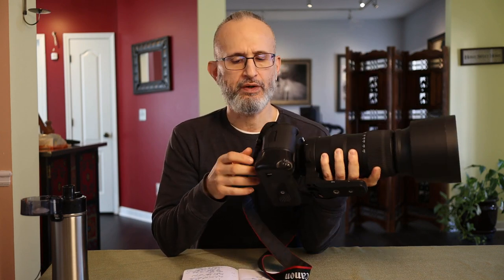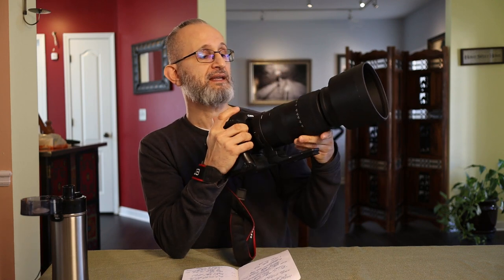This thing is built using three different materials. The inside is a magnesium alloy core — it's got to be metal because this thing is rugged, holds all those glass elements, needs to be tough and strong. The outside is a thermally stable composite (TSC) — basically a plastic that doesn't expand and contract much when it gets very hot or very cold. So if you're shooting in the Mojave Desert at 115 degrees, this thing is going to get hot, but it's not going to expand so much that your glass elements move and your pictures go from focused to blurry. That won't happen thanks to that material.